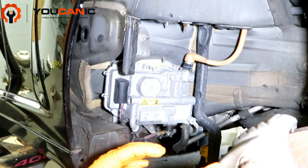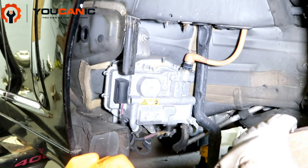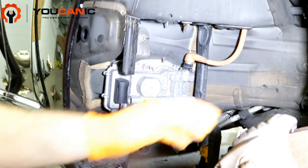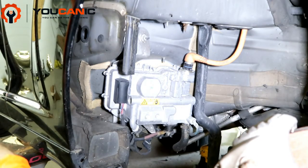You want to make sure that you actually follow our step-by-step guide because this is going to be really quick and we might not go over every single detail. You basically would disconnect the 12-volt battery that's in the trunk first, and before you even do that you should actually de-energize the high voltage system.